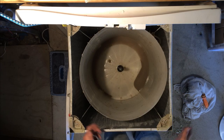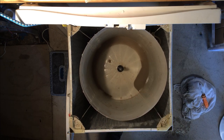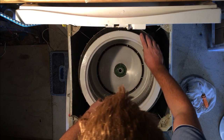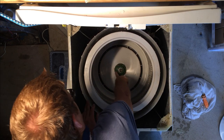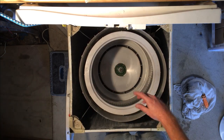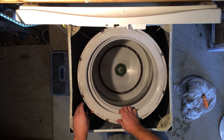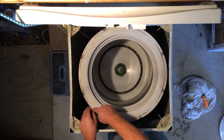Alright, so now we're ready to go back together. We've loosened up that dust and stuff, and cleaned out the bowl. It's just a case of reassembling in reverse order. You'll notice there's a little green clutch spline here — we don't need to take that off, it just slides right off. Next is the neck ring. If you've ended up taking the spring off and want to know which way around it goes, you have a little notch different from the rest for the spring.